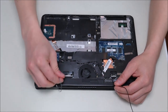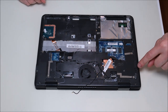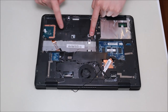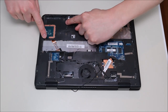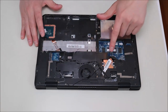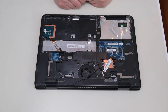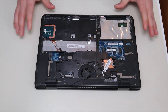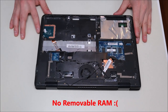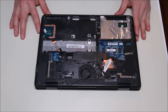The black antenna wire routes to one side and the gray or white one to the other. To get more into the computer there are screws in several locations across the interior — you'll see them here, there, and over by the panel. You don't have to do the CPU heatsink screws yet; take off all the other screws to get further in. For those of you looking for RAM: the RAM is integrated into the motherboard on this computer, so you cannot easily remove or add RAM.